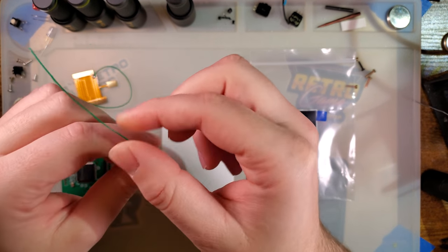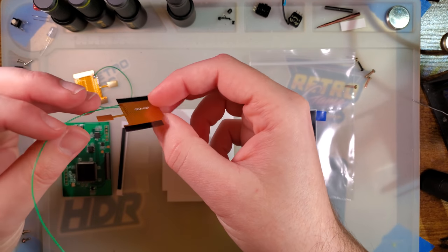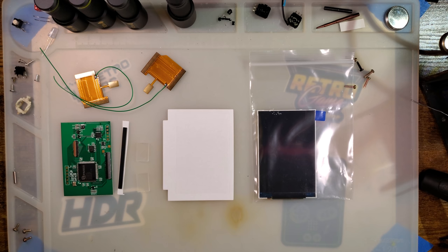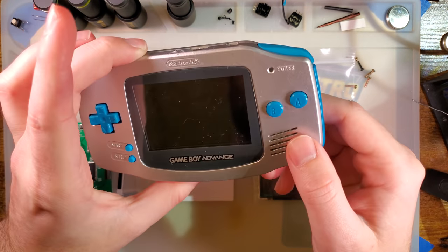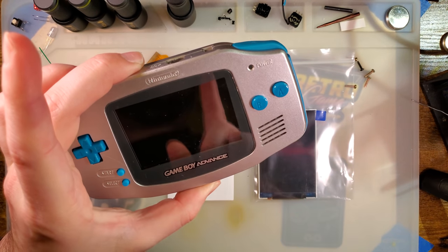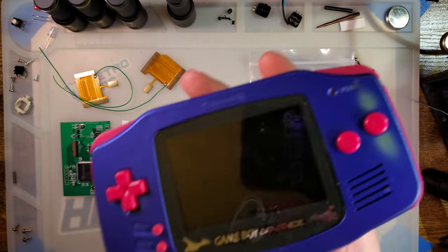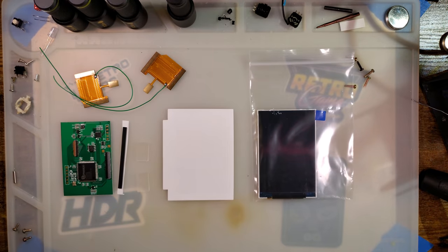The manufacturer does actually say it is drop-in, and they say just strip the wire down and wrap it around the battery terminal. That's such a bad practice — it's actually hilarious. These kits are not drop-in in the strictest sense of the word, but they are designed to be installed within an OEM shell. I did actually do an install of one of these in this Game Boy; I'll link it in the description. In that video you can see I installed it in an OEM shell with an OEM plastic lens — no cut. In this video I did do a little bit of cutting, if I recall correctly.